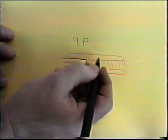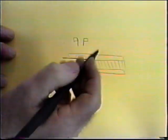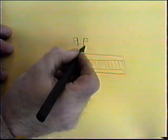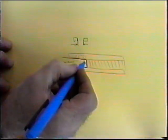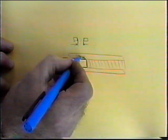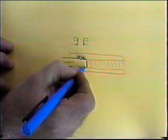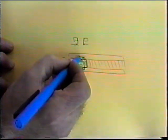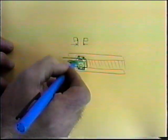And then I build a crutch, which I think is the way almost everybody builds fuselages now. It doesn't even pay to go into a dissertation about how else to do it. But by knowing that this is the widest it's ever going to be, now I can put in smaller motors. I can always get the ears to hang out over here and put new holes in for the bolts. In the case of some of the 40s that I was testing, they were kind of thin, but they always had enough material that I could get back out to where the Super Tiger holes were. It was never a problem.